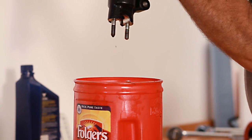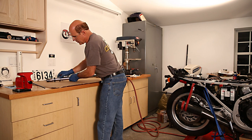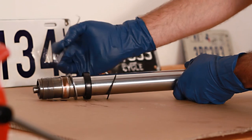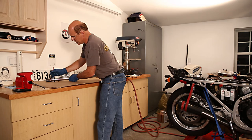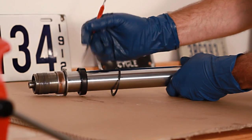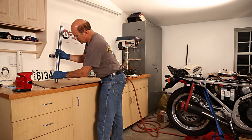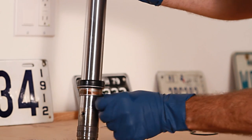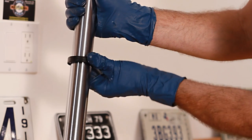There it is. There's still going to be some oil left in here. Before I actually pull the seal out — which is the last stage of disassembly — I just want to show you how it actually works. When it's all together, you've got a lower fork bush which slides up and down inside the tube, an upper bush which sits in a recess near the top of the tube, a backup ring, and the seal itself. The seal will come out by pulling up very rapidly while the tube is in the fork. The lower bush acts like a slide hammer and pushes the seal right out with not too much effort.